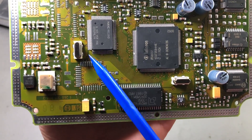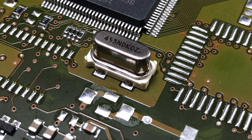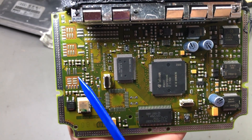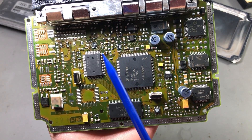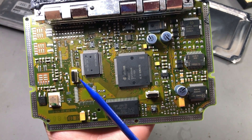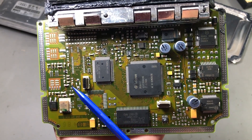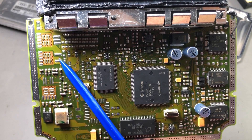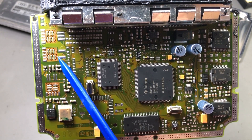Then we have a couple of crystal oscillators, and each one has its own small mounting base. I'm not sure why they did that — maybe it's for mechanical stability, because this thing will see quite a lot of vibrations during its lifetime. We also have some unpopulated footprints, and that's because they often design these ECU systems capable of controlling a V6 or V8 engine but also want to install them on a 4-cylinder engine to recover the investment, so they don't populate all the output drivers. It's also interesting to see the paste coverage they have in the stencil for these high-power packages — maybe about 30% coverage on the tab.